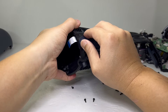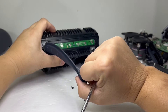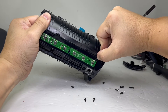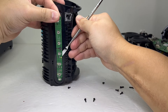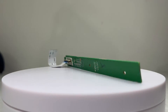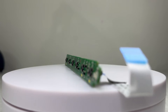Next, let's get access to the main control button board by removing the top silicone cover. Make sure you peel it off cleanly so it can be reapplied back on. The control board itself is double-side taped onto the enclosure so you have to gently pry it off without breaking it. This control board contains six of the top buttons along with four LED indicator lights for the buttons and battery life.